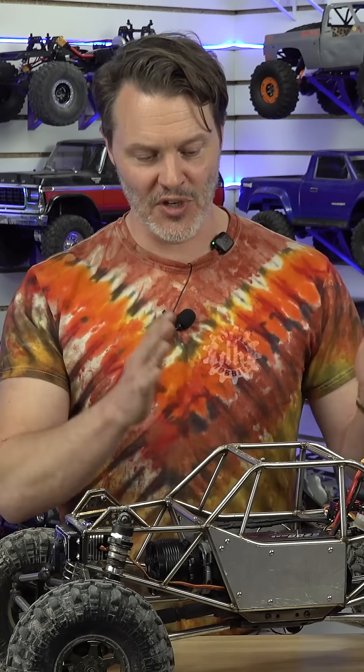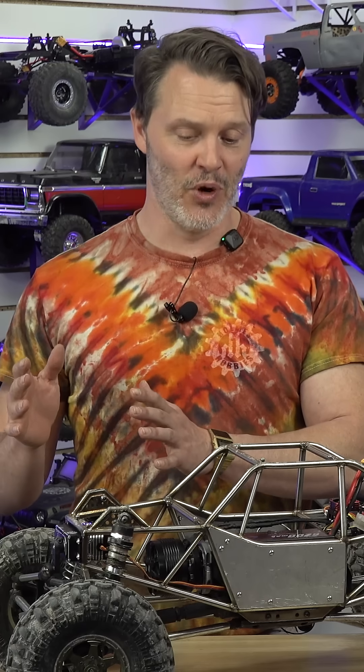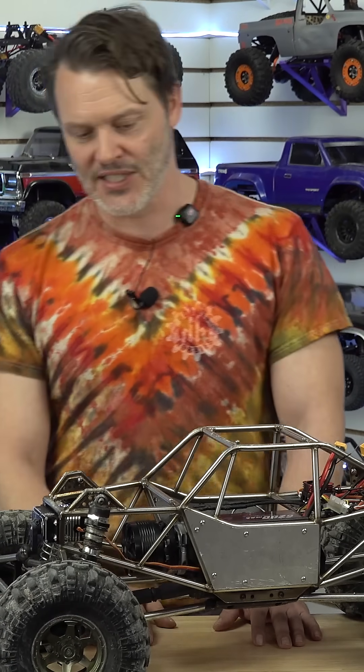It just couldn't handle the back EMF of the motor. When you release the throttle, the motor is pulling a certain amount of amperage and wants to continue pulling that amperage. So the voltage spike you get when you release — on this particular motor, because it is so big and has such low reluctance — oh boy, let me tell you, it's a serious problem.